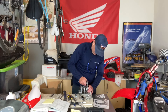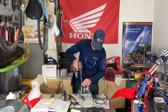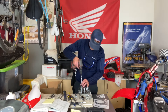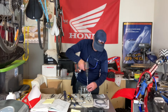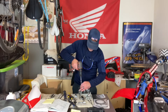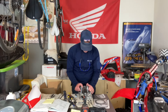Obviously if you're doing this work with the engine in the bike, you'll have the gas tank removed and you'll be working through the top of the engine down through the frame. Here I have everything disassembled so I'm doing it on the bench, which is more convenient. Because I switched out to stainless steel valves from titanium valves, we have a different gap and I'm going to have to reduce my shim size.